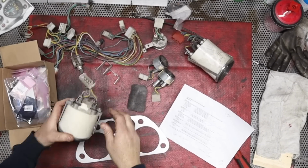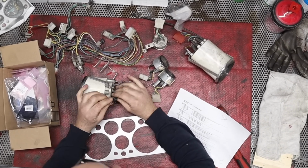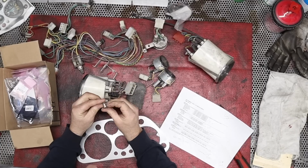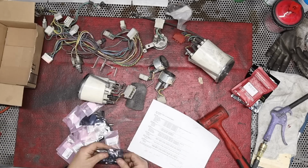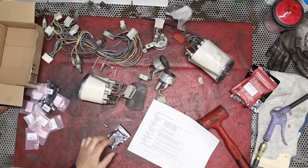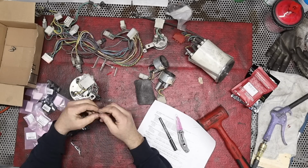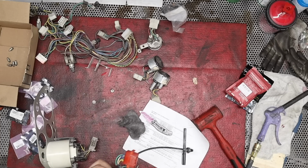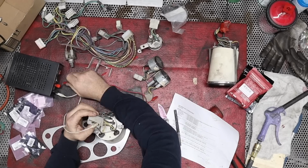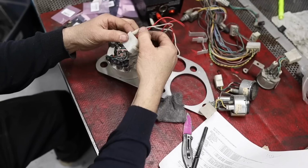Ferrari chat member Plutonium for the win. Thanks for sending me this list of LED replacement bulbs that has been compiled and is readily available for anyone who dares to do this themselves. But I'm being melodramatic because it actually wasn't that hard. The smaller bulbs, the ones that can go in two different ways, well, you actually have to check to make sure you have them in the correct orientation, or they won't work. Go figure.